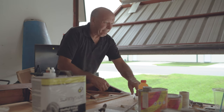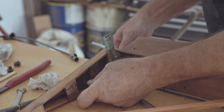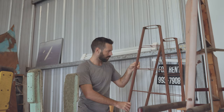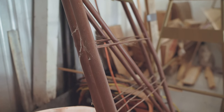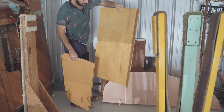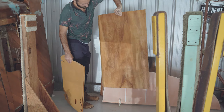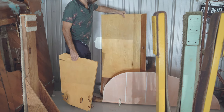Besides finishing the repairs on the flaps so we can start fabricating the smaller pieces, we also need to recoat the stabilizers with the proper coat to be able to fabric them, and get a canvas made up for the back seat. Brian also made up a new back floor — look at this beautiful new back floor. He's done the front floor and now the back one.